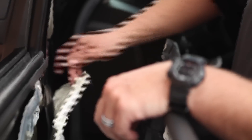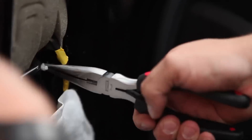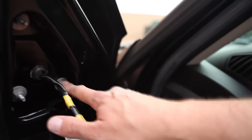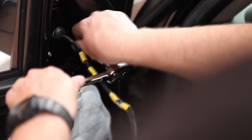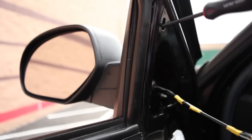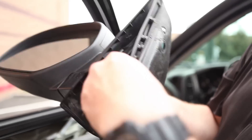Since we're not disconnecting all of the wiring, rest the panel on the two long alignment tabs on the bottom. You'll see the loose mirror harness — follow this towards the mirror, noting the three pressing clips used to hold the wire in place. To pull the clips out, use a pair of needle nose pliers. Don't fret if you break these clips; the tow mirrors come with new clips. Just make sure to pull out the stubs so they don't fall into the door and rattle later. Now remove the foam insulator and reveal the three mounting nuts. Using the 10mm socket and ratchet, remove the three nuts. The mirrors have clips in place so they won't fall off. With a large flathead screwdriver, push or pry the clip at the top of the mirror to release it from the door, then remove the old mirror and pull out the wiring harness.